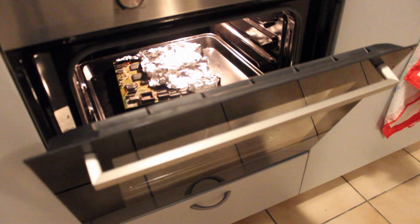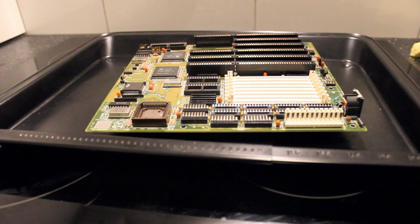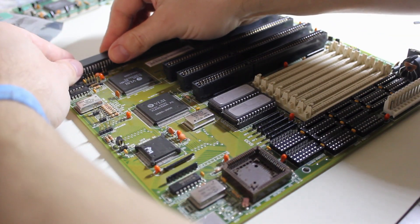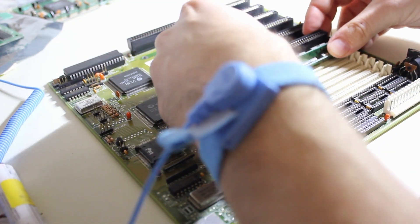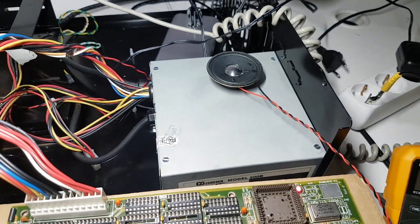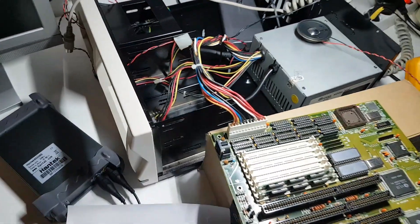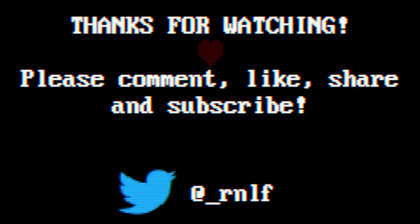I didn't want to risk the stress of a quick cooldown to cause any new problems. Luckily, all the plastic survived the procedure unharmed. When the board was cooled down sufficiently, I got it out and reinstalled the chips I had removed before. I installed the VGA, power plugs, and PC speaker, crossed my fingers and flipped the power switch. And to my great relief — it worked! I am editing the video 3 days later now, and still every time I pass by the machine I boot it up quickly to see if this fix is permanent. So far it seems to be — it boots fine every single time now. All the ISA slots seem to be working. So the rest of the 386 project is saved and I can now continue with the actual next video of the series.